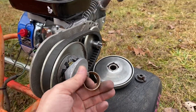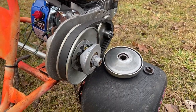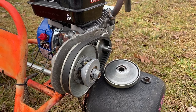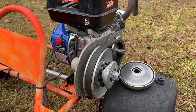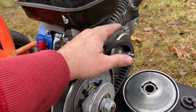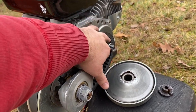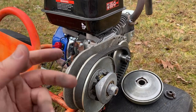It's up to you whether you use this bushing or not, but I'm going to make sure I continue to leave this off all of my torque converter installs so I don't have any issues in the future and end up getting hurt next time. If you're worried about your belt getting worn, I've run my other torque converter for years just like this with no bushing and it doesn't seriously reduce the belt's life.